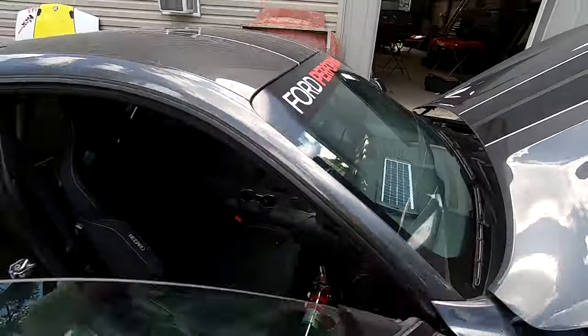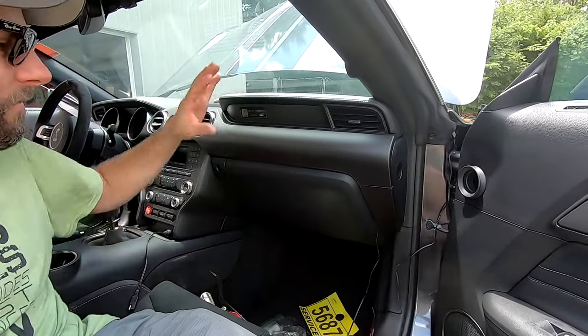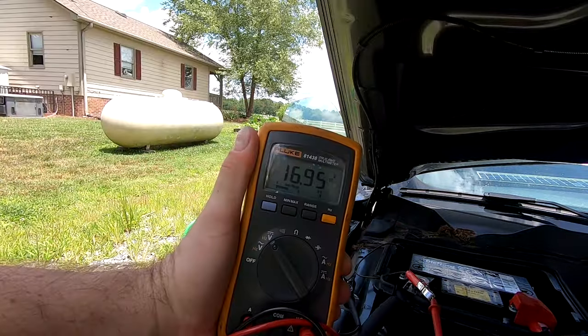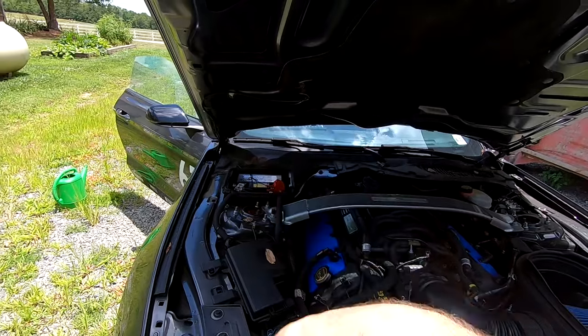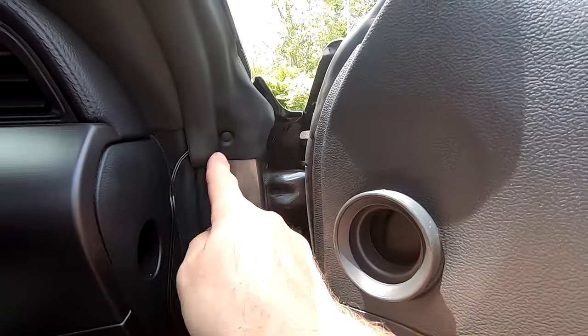You can see the solar panel sitting there. My plan when I start driving this thing more - it just fits into the glove box, close it up, so I can drive around and it's not flying all over the place. Then if the car is going to be sitting a while, you put it out on the dash. We're going to check it real quick - 16.95 volts. The way I have it ran it should clear the hood and the battery tray cover. The last thing I'm going to do is try and tuck this wire up and in - I tucked it up and under this little bit of weather stripping with enough slack to put it wherever I need.